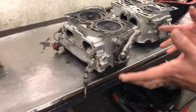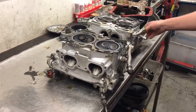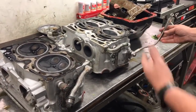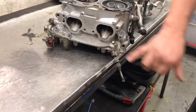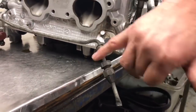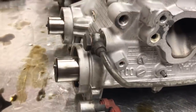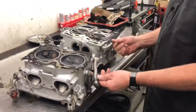The other thing he didn't realise: on a B4 there are obviously two heads and two turbos, and both turbos need an oil supply. One of them has been replaced with an aftermarket flexible one — that's fine. But the original one someone has just crimped off with a pair of vice grips, and that is what's stopping the oil pressure. What should have been done is that fitting should have been removed and a blanking plug put in place.